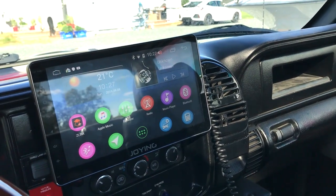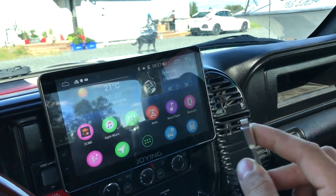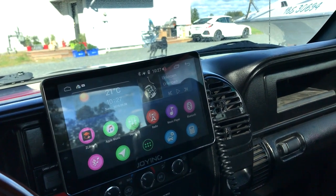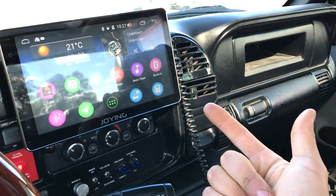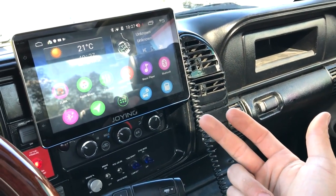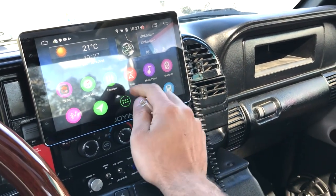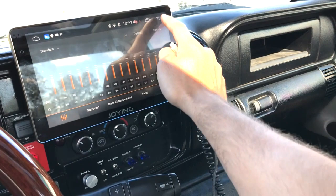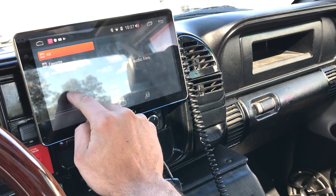What I didn't like about the other head unit was that if I was hooked up with a lightning cable to Z-Link for CarPlay, anything else hooked up to USB would get shut down — it would kill the protocol for that USB. So say I had a TPMS module sensor, a USB hard disk, and another USB hard disk with music — as soon as I plugged in my phone via lightning cable, all my USB connected stuff would be gone.